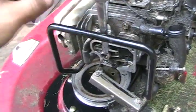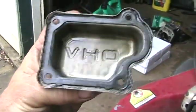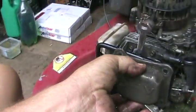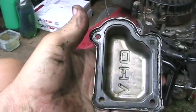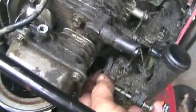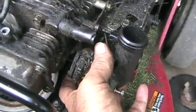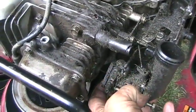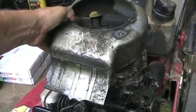Make sure just everything's snug before you put it back together — but not too tight, those bolts aren't that strong. Cleaned off the debris around that gasket; it's still in good shape so I'm going to reuse it. Put it back on and torque it evenly too — it wouldn't hurt to put a little bit of silicone around there. Now don't forget when you put your carb on that the heat spacer separator gasket is still there. Make sure your PCV ventilation hose gets put back on the nipple so it doesn't blow oil all over the motor and make smoke in your face while you're pushing it. Air duct cooling cover thing on.